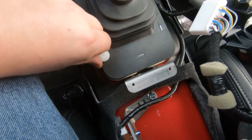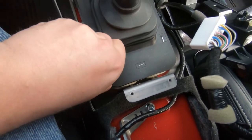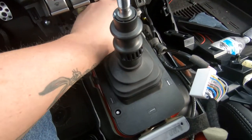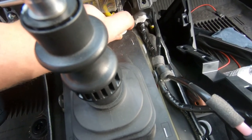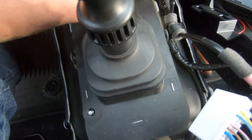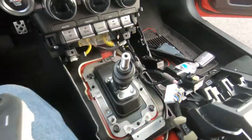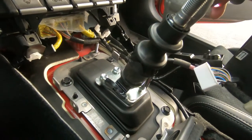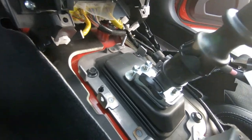You'll want to separate it right at the seam — there's a little catch that you just push in with a flathead. Twist these little white caps off — they're super loose. Some videos say you can pull them straight out, but I would not recommend it as that will break them. Just twist left like you're undoing a nut, and then pull the little rubber housing straight up — it comes out pretty easy.